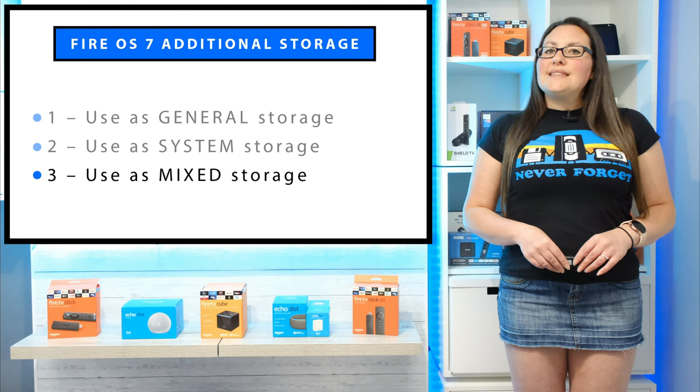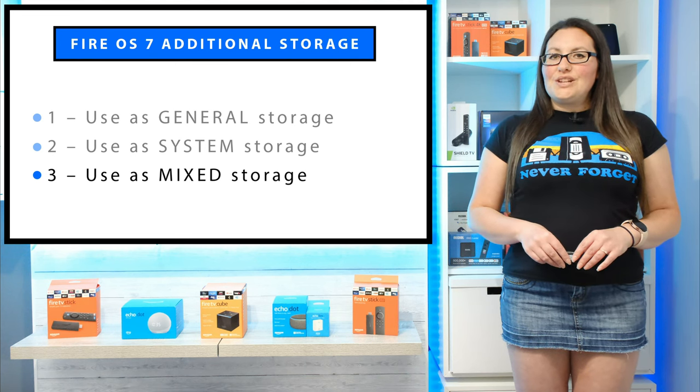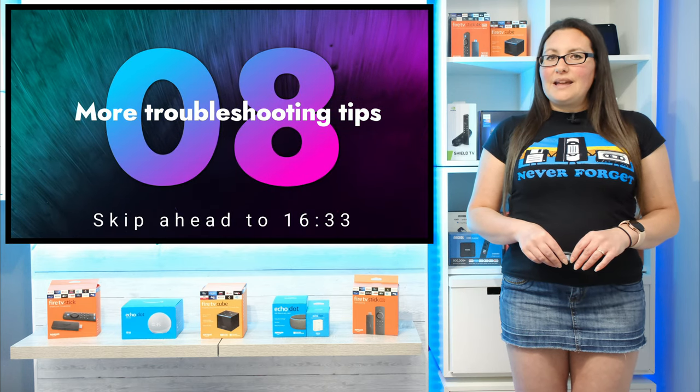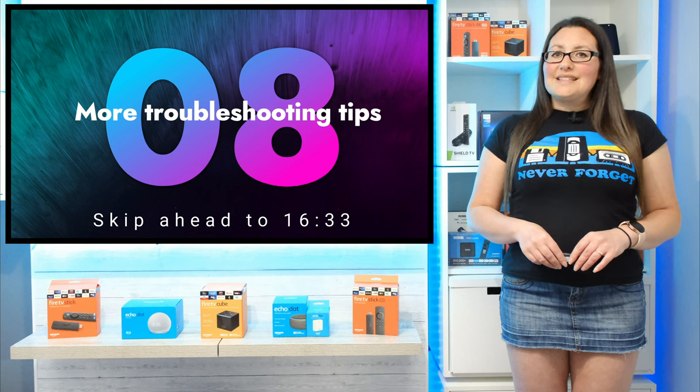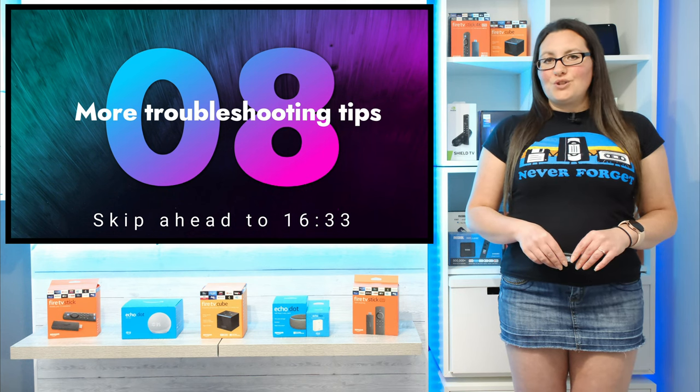If you still can't see your storage and you're sure that your storage is formatted to FAT32, you're sure that any ADB command was completed successfully, and you're sure everything is connected correctly, skip to this part of the video for further troubleshooting tips.